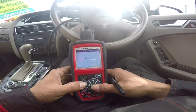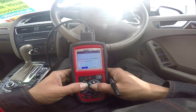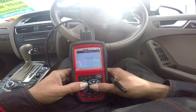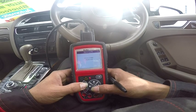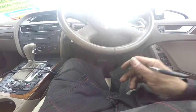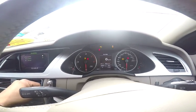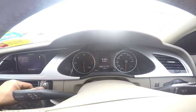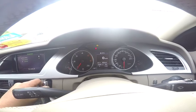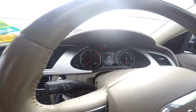I'm going to clear the light again. I was able to clear it again, so I'm just going to turn off and start again. That's one turn off, on again — two ignition cycles, it comes back on again. So we have to manually check this. This is a hard fault, that means this car really has a problem on the circuit.